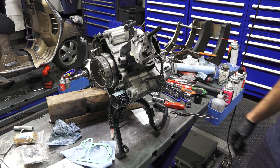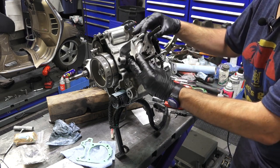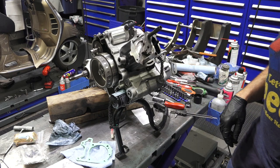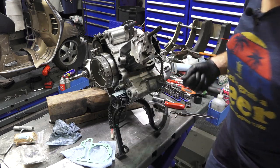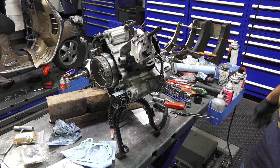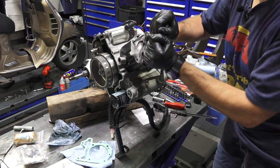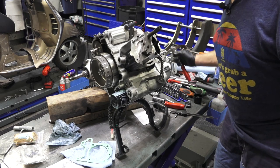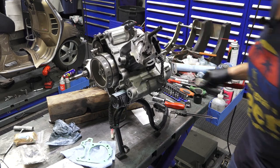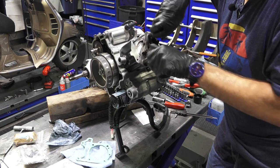Another way to go about this is if you had a flat piece of bar and drilled two holes in it and bolted it down to the top of your cylinder here. And you could go all the way up and try different combinations of feeler gauges that derive that 3.7 to 3.2 measurement. And again, it's a little different for different engines, but that's another way to go about it. Or you could just give it a wild guess and just put a 0.6 in there and you'd probably be fine, never have any issues. So all up to you.